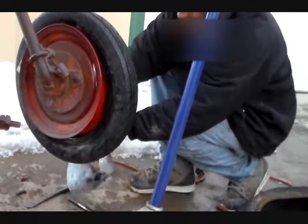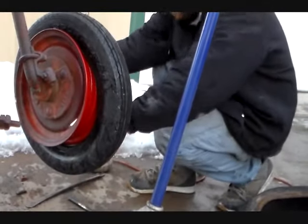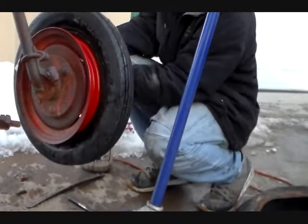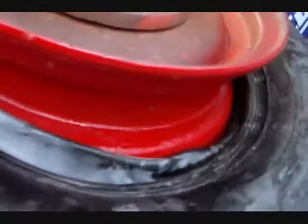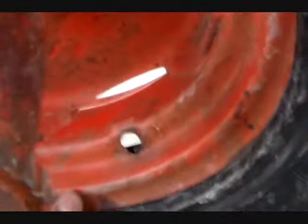When they put these tires on the shelf at the store and stack them flat, and they sit that way for a while, they're really a pain — the beads settle together, the sidewalls kind of collapse in. If you're trying to do it tubeless they can really be a bear to get the bead to set up once they've been collapsed in like that. I've got it stuffed in there, and from the back side you can see the tube around the rim. Now I've got to get the tube worked over the outside bead of the rim, get the valve stem lined up and through that hole.